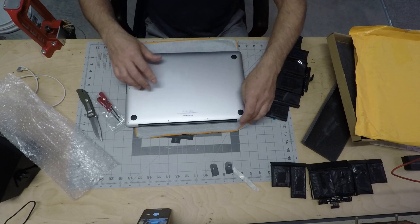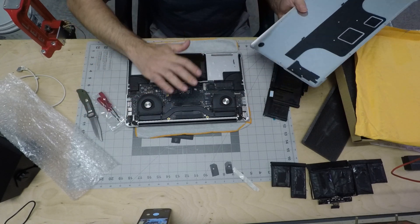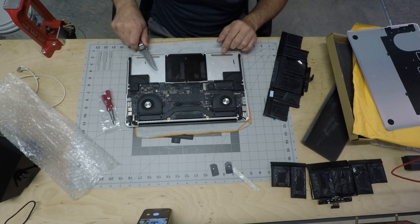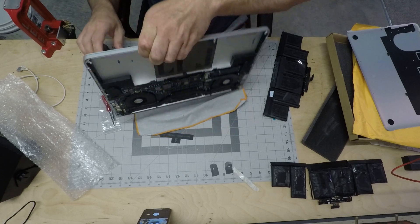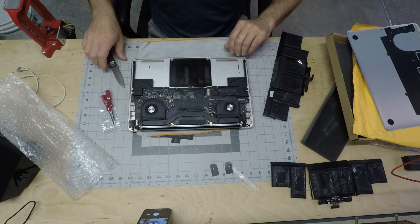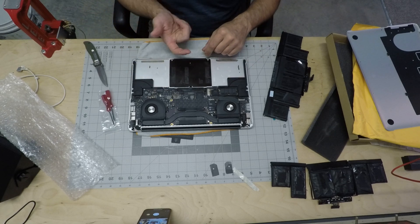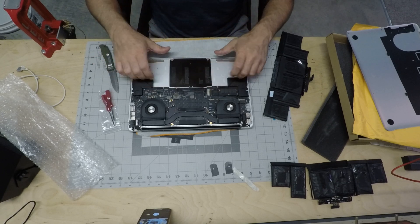Once you get the cover off, this is an excellent opportunity to blow it out with a can of compressed air and make sure everything is nice and clean. Now, the original battery was glued to this panel with double-sided tape and it was stuck for life. Please do not use screwdrivers or anything to pry it out — I pushed too hard and left a small dent. What I would use is a credit card and work it out gently. Also be careful of the touchpad on the other side — don't puncture it.